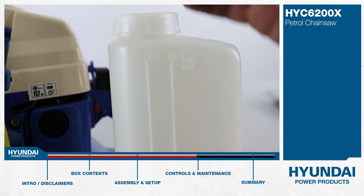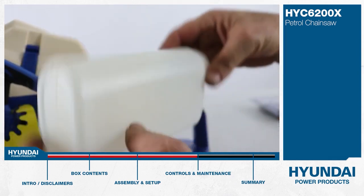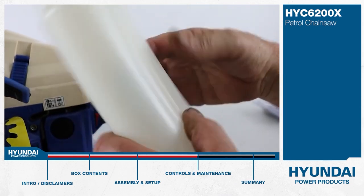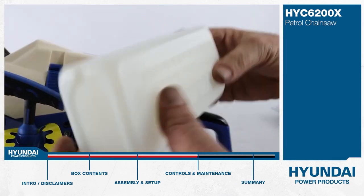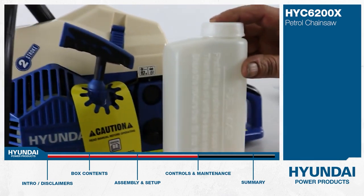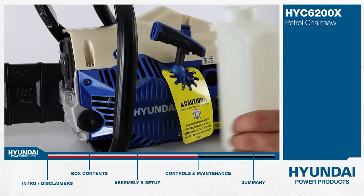Once you've done that, make sure you've got your lid firmly attached. Give the bottle a few good rotations and shakes just to make sure that that two-stroke oil is well mixed. Give it a little shake. Once it's mixed, let the bubbles settle, what have you, and then that fuel in this canister is ready to load into your fuel tank.